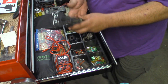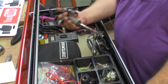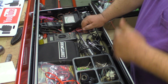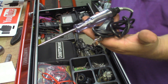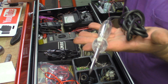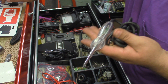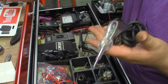I've got my soldering iron here for soldering. This is just a cheapy little 30-watt — I've got higher and lower wattage irons, but that's why I keep this one in my toolbox for most automotive repair. It's a Radio Shack one. I have a cheap incandescent test light — this is probably the tool I use the most out of any of this. I also have an LED test light that shows polarity with red and green. LED test lights are very important for specific situations, but I normally don't use them because they don't draw any amperage. There are situations when you want to see if there's voltage present without loading the circuit — they're handy for that.